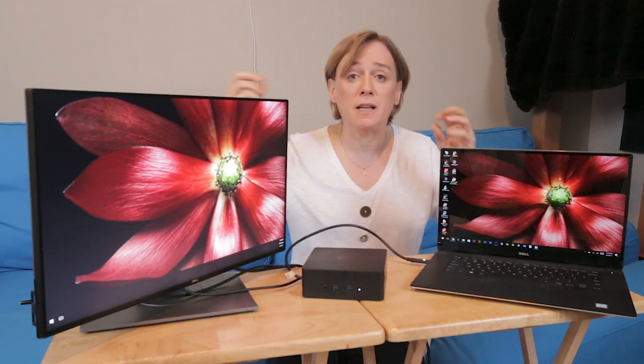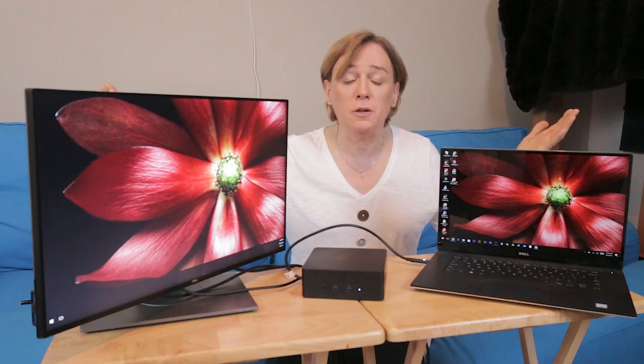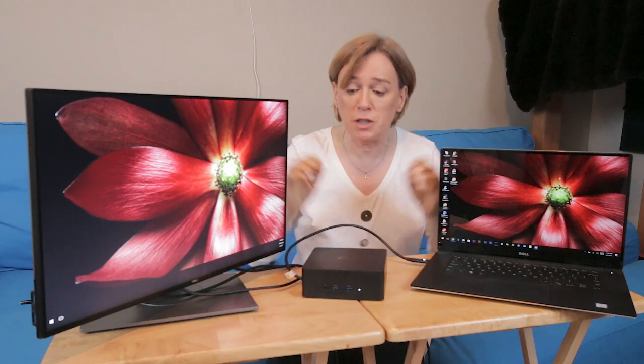The most optimum way to lengthen a cable is really to just have a cable that's a solid single cable of the length you need for the technology in question — in this case, Thunderbolt 3. So extending this cable with some ad hoc extension cable is probably not going to work, because the wiring is not going to be correct in such an extension cable.